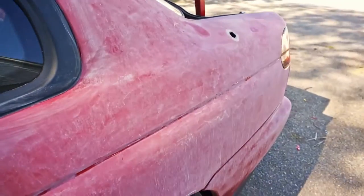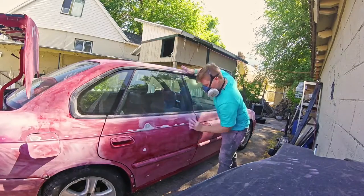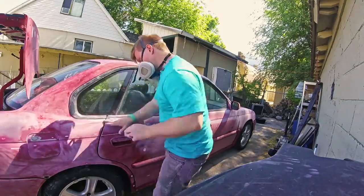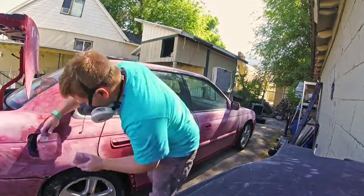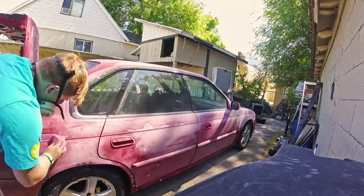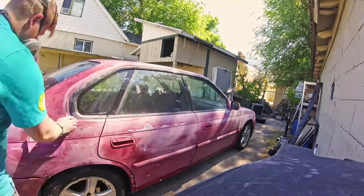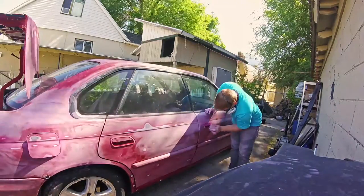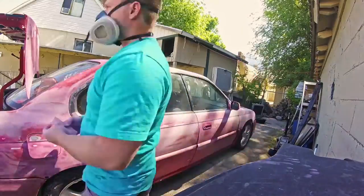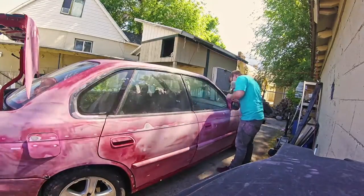Proper prep is essential for a good paint job. In the week leading up to actually getting paint on the car, I spent hours and hours prepping. Since the paint job was in pretty good condition without major scratches or peeling top coat, I sanded the whole car with 320 grit and called it good. I was planning on painting with Rust-Oleum enamel, which is really thick paint — because of its thickness it's capable of filling all the scratches left by 320-grit sandpaper. If your car's clear coat is peeling, I'd recommend using 220 grit to sand away all the top coat, then going over it again with 320 or 400 grit for a smoother surface and a cleaner paint job.